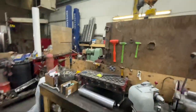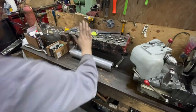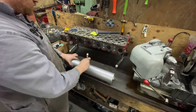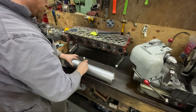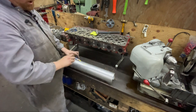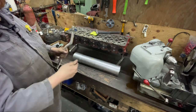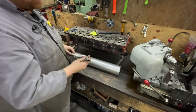Let's get into showing you how this is done. I don't have the piece of pipe I actually did it with — we used the last piece on there — but I'll demonstrate with this. Pretend this is the exhaust in the truck. Basically what you're going to do is drill a hole — you go straight in with the drill, then crank it on an angle because you want that tube to go inside on an angle. You want to use a piece of 5/8" tube — so your OD is 5/8" — or you could do 3/4" OD, just depending on what you can get.